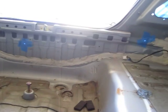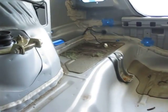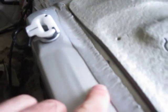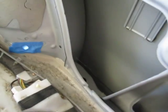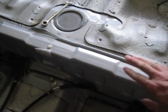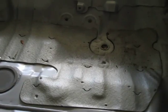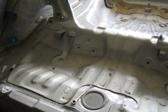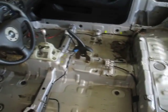That seam sealer, if you follow it around here and around the bottom of the strut tower, then it kind of comes around here. This seal across the front is what will be replaced — it's all around here. That whole section, all the way up to where the front of the back seat sits — all of that is what gets replaced in this conversion. Basically, we'll be doing a lot of rust repairs at the same time as doing the floor, but this car is pretty solid.